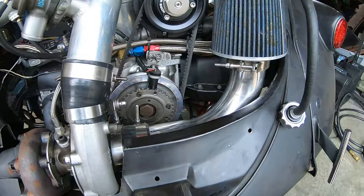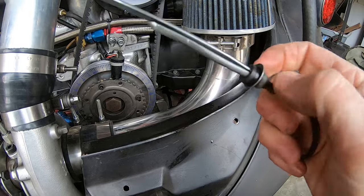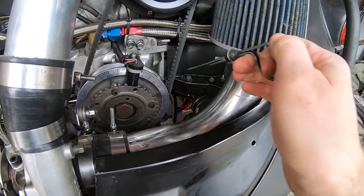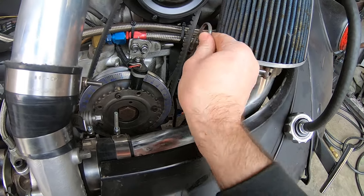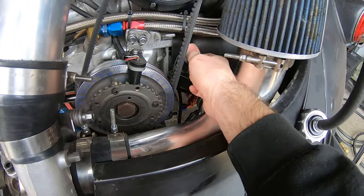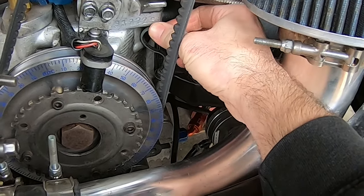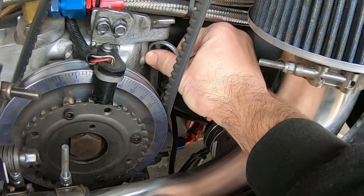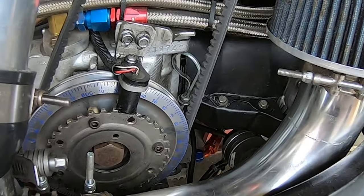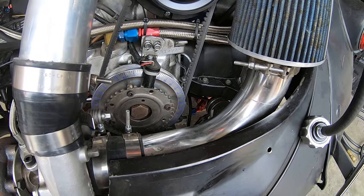Show you guys a little trick. I grab a couple of these little round squared off O-rings out of a leftover gasket kit. Kind of works as a seal, you know, if you're running your old original dipstick. I'd actually like to get one of those sealing dipsticks in here, but if you put it down here, you know, that's good. But if you actually rotate, a friend showed me this a long time ago, and kind of press it down underneath here, it'll kind of almost click in there. Yeah, it'll actually lock underneath your generator stand down there, and those O-rings will help seal down on the bottom. But yeah, a little helpful hint there.